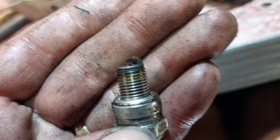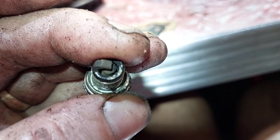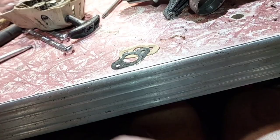The spark plug was burning pretty good — not too bad. First thought it was fouling up. Not too bad I suppose. It was probably running a bit too rich — too brown.